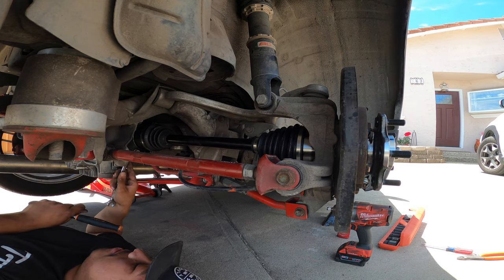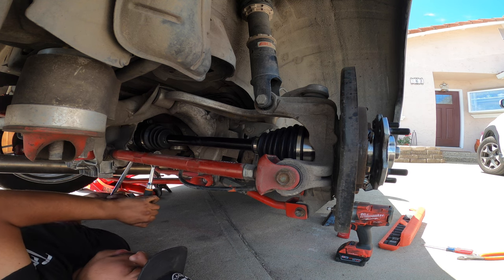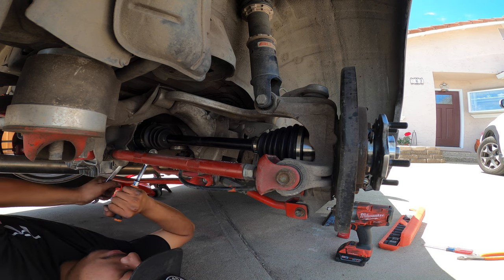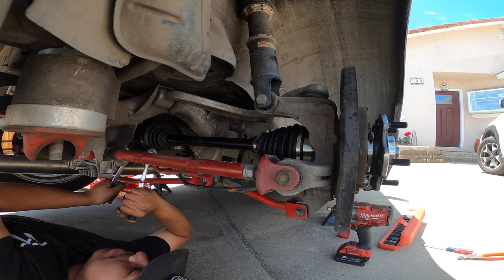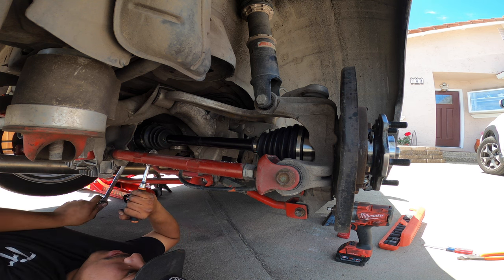No pasa nada. Solid everything, shock loads everything. Why, when you do a launch in this thing, anytime you're launching, I think any car for that matter, you want to drag the clutch. I can't just send it like I've been. You kind of dump the clutch from the floor, don't you? Like, your clutch is pushed all the way down to the floor and then you dump it. No, right before the launch, my car's creeping very, very slowly. So I'm almost out, and then once they raise their hands, I'm out.